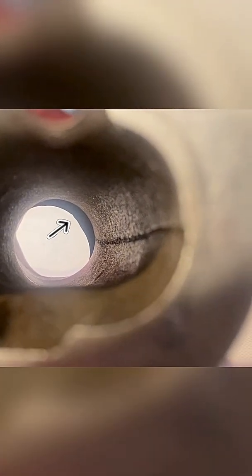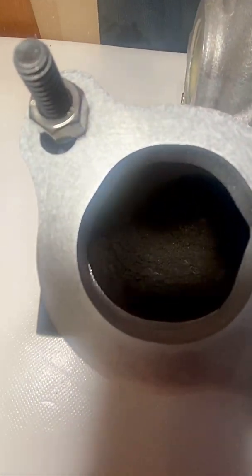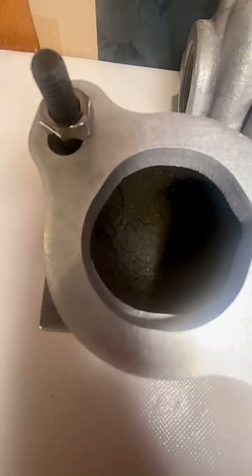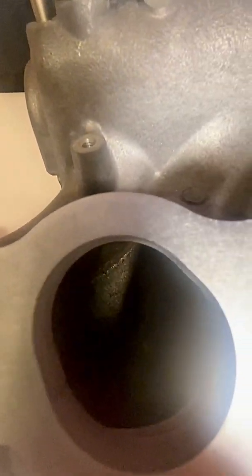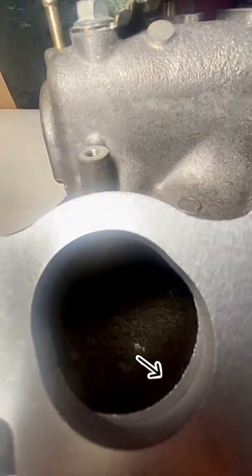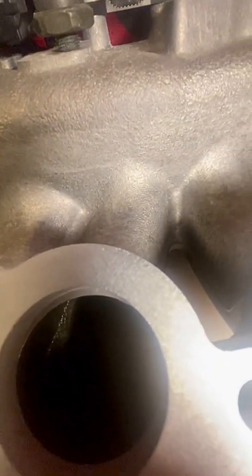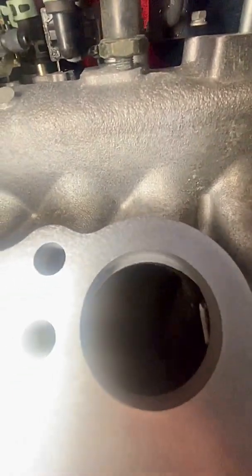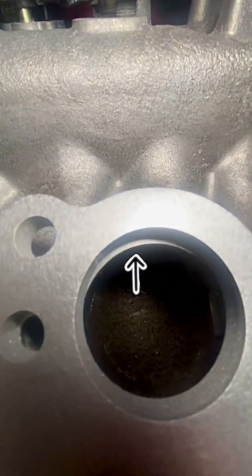This is the last runner. Here's a view of the GE-to-GTE adapter plate bolted to the GTE upper intake manifold. The little protrusions on the bottom of any of the runners — you're just going to blend that in and port match it to the adapter flange and vice versa. You'll also match the adapter flange to the inner diameter of the GTE manifold. Most of the modifications are done on the flange.